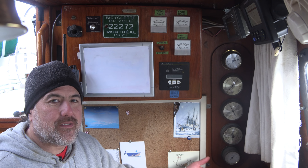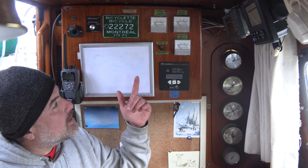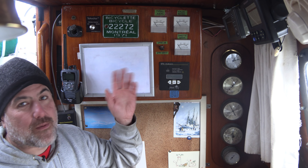I'll show you the D400 generating electricity later in this video, but first I'd like to show you how we wired up some of the components of the D400 down below. I ran both of those 12-volt cables from the D400 to this box just above the dinette table and installed most of the components in there. I did this so that I could always see how many amps are flowing from the D400 at any time on these amp meters. These inexpensive amp meters aren't included with the D400 and aren't necessary for the installation, but I thought they'd be great to have.